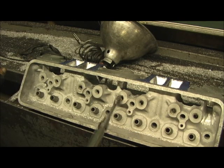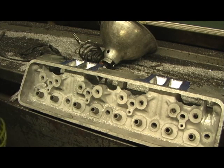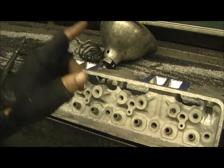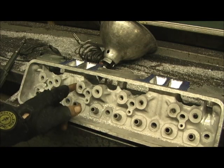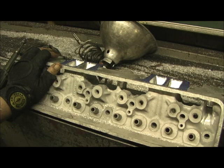I just wanted to show that little part there. I took a few minutes, I clean it, I go through them all — just part of the process. And you keep your eyes open, because I cannot tell you how many times I've done this and caught casting flaws and cracks, because now we're on the edge of doing the final blending and the touch-up and this is when you better pay attention right here.